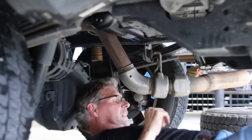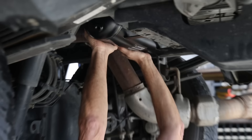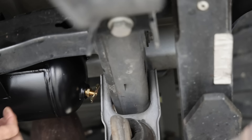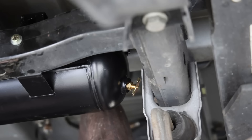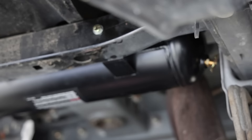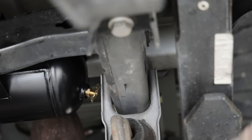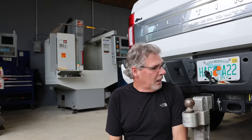Even using the lower holes it's very sturdy. The water drain is easily accessible, and to let air out of the tank you can use the water drain — you can slowly regulate it and let the air out. Problem solved. Now we have to mount the compressor, and that's going to take some thinking.